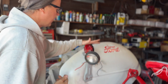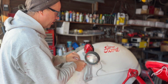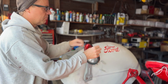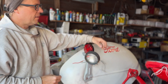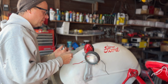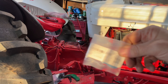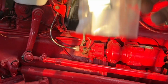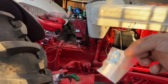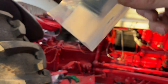My goal here was not to buy any lights. I had this tail lamp just sitting on the shelf and a Napa plow light. The difference is that the tail lamp has a ground wire and a hot wire, whereas the Napa work lamp only has one power lead — the ground is actually on the bolt that goes to the bracket. To make this work I'm going to run a ground from the battery, hook it to the tail lamp, and tee off the tail lamp to the post. You can get original-style clips that match up with the bolts for the transmission, but they are a bit pricey.